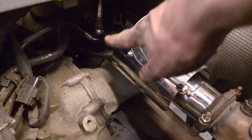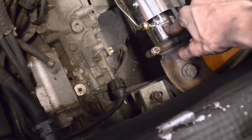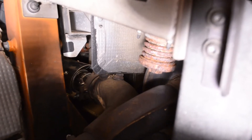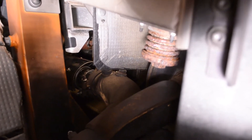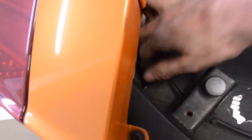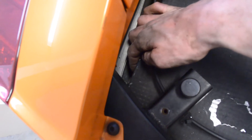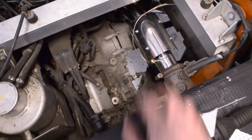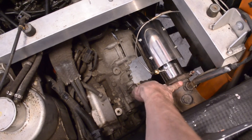The hardest part was getting the clamps in the front. If there's a gap between the pipe and the exhaust, you can loosen up the exhaust by undoing this bolt right here and this bolt right here with a 16mm wrench. Underneath there's also a spring-loaded bolt — mine is very rusty on both sides. Put your hand through here and put a 16mm wrench on that bolt while you loosen the spring-loaded bolt underneath on both sides. Then you should be able to have the exhaust loose enough to get good contact between the pipes and the actual exhaust.